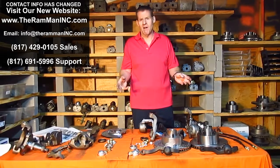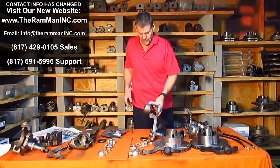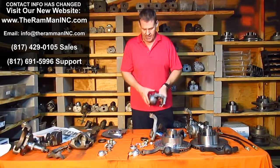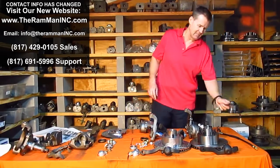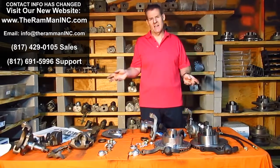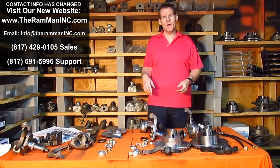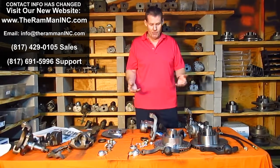Mother Chrysler resolved that problem. Very few people know it, but Chrysler did make a rear mount sliding caliper that we substitute in. The bleeder and the hose intake are on opposite sides, so you get to run the factory hoses. These engineers sat around and fixed all these things. They didn't let a little problem like that blow them away. So, you know, there's lots of articles about this and how to do this and that. Well, just say, hey, Wayne, you know what? I got a big old factory sway bar up front and we need to run the rear mount calipers. It's a little bit of an upgrade charge, and voila, completely fixed, factory components, done right, and no problems.